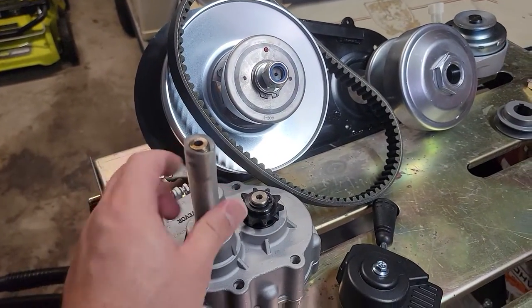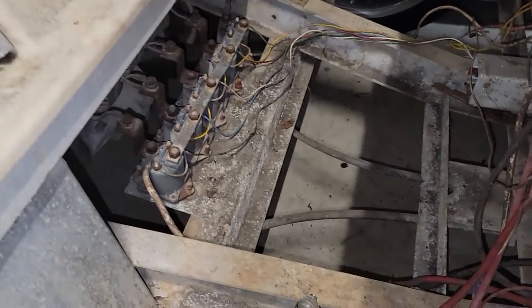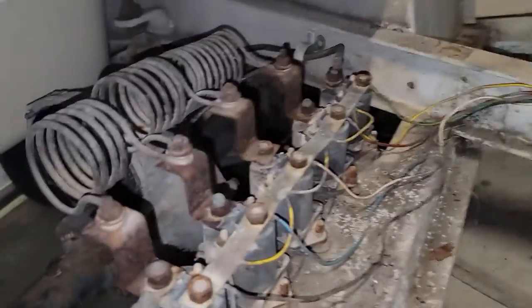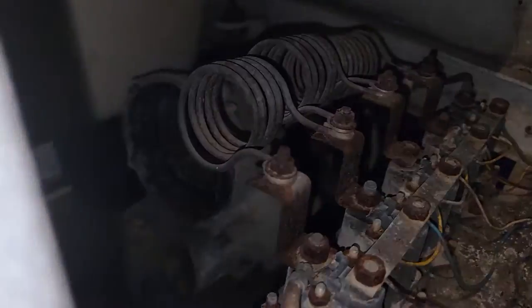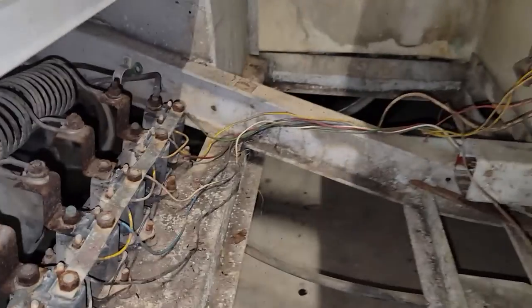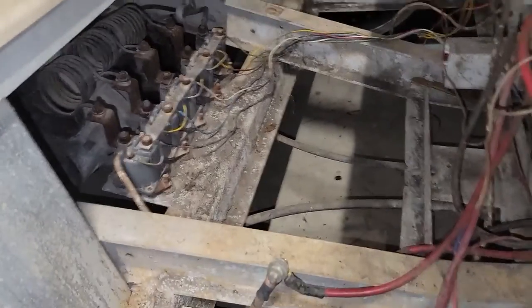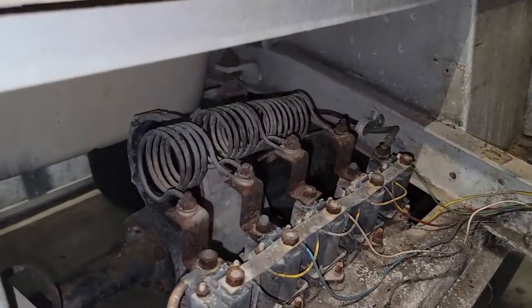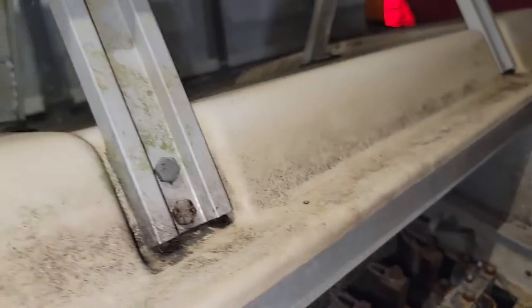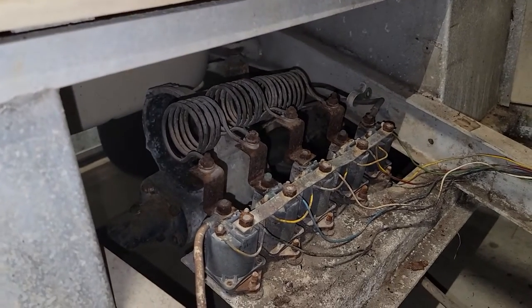The gear reduction on this is about 1.3 to 1. If you guys have any suggestions on what sprocket size should go on the back attached to the motor, drop a comment — I'm not really sure there. For mounting the engine, I'm thinking to mount it to the gearbox itself since the gearbox articulates with the suspension on leaf springs. If I mount it elsewhere and hit bumps, there's a high chance of throwing the chain. I was debating aluminum or steel, but with all the vibrations and potholes, steel is probably the best way to go.